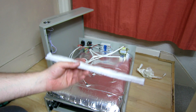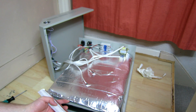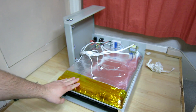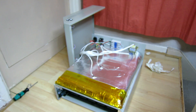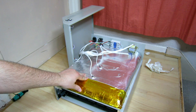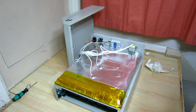There's this bit of insulation that goes in here at the front and that's got tape on as well. You're going to have to pull that out from underneath here at the front and get the masking tape off that as well. It's literally just sticking a few strips of polyimide tape over this front area here up to the first temperature sensor. That's it for stage one. There are other improvements we need to make for this oven, but for now we just want to get rid of that nasty masking tape so we don't have to smell burning from around the house.